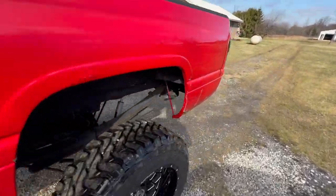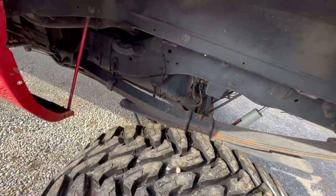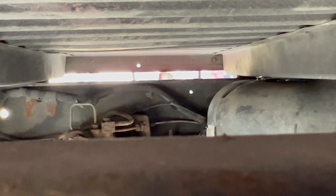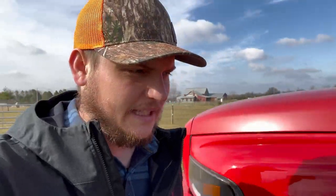There's no leak there still, and I don't see any fluid spraying anywhere. But I'm going to get under and look just to be sure. I don't see any fluid leaks around either of the fittings, so it doesn't appear to be leaking anything, which is a good thing. Doing brakes is one of those things you can do yourself, but it's a pain when you're trying to pump the brakes, crack a line, and check for fluid. At least now I know the line's not leaking — at least not yet. It might change once we get solid pressure in the entire line with fluid, but currently it's at least not leaking.